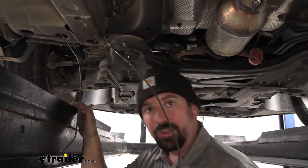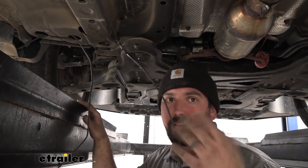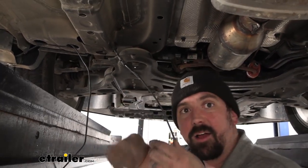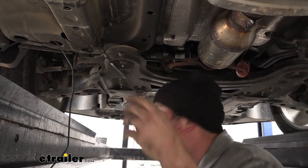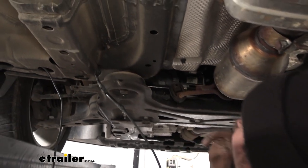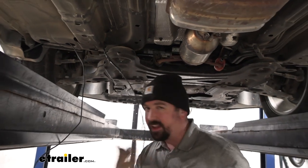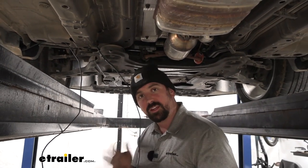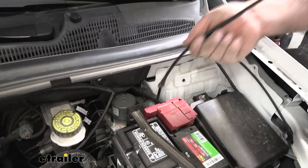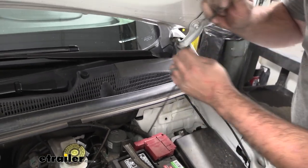The rest of my wire is taped up to an airline tube, and this is going to help me pull the power wire up to the battery. If you don't have an airline tube, you can use a weed eater string, a coat hanger, or anything that will allow you to pass it down, tape it up, and pull the wire up. Up on top there is the steering column, as well as your axles and sway bars, so make sure the wire is nice and taut and not going to get caught up around any of those. Double check when you pull it up.